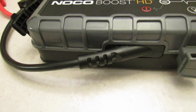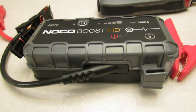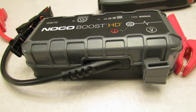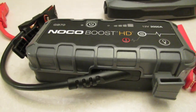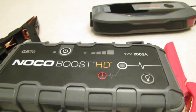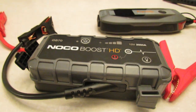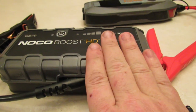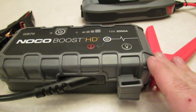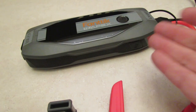If you guys could do me a favor — if you have a GB70, check what voltage is coming out of it. Test it with a test light or a multimeter, that's the real way to do it. This unit is only letting out 11.9 to 12.0 volts, which is very low compared to all the others — but Noco considers 12.0 normal. These other ones letting out much higher numbers would explain why they start vehicles a little more easily than the Noco does.